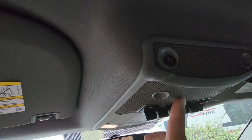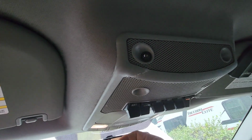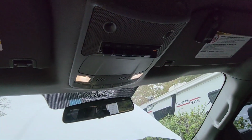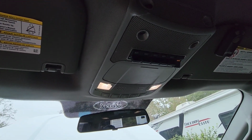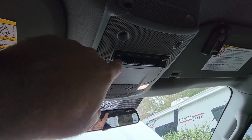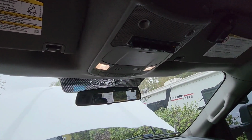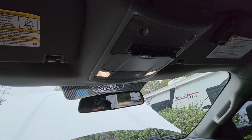This way I'm not hitting it, and I've done it before when it was not spring loaded. Hit that and then go, oh no, it's still on. You got to flip it back. So we made both of these spring switches. Takes a little time. You got to take the box apart. We used a spring out of a pin and some big monofilament, like for fishing, and drilled a little hole through it because it's just a little slider switch in here, and made it work, and it's worked great. I don't know how much air's in there right now, but now my key's on, all these light up, right? Just that simple. I like it.